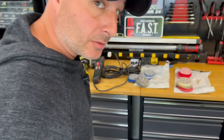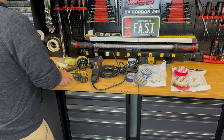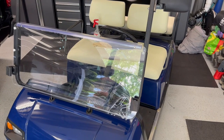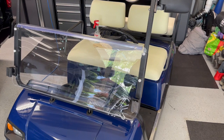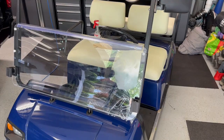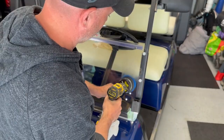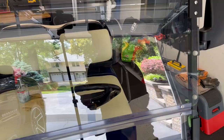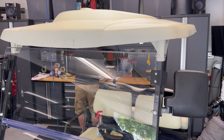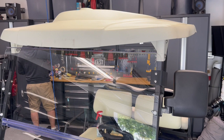Again, this is not a paid advertisement — I got no sponsors. Let's try and get that little scratch out of this front windshield first, then get the other windshield in here and knock that out. The Adams pads will adhere to this Meguiar's little drill buffer. The scratch is gone — I know I've been having a hard time showing it to you, but trust me, it's gone. After you do the compound, I've got to put some polish on it because it does fade it out some. So now we'll smooth it back down with polish, and this should be ready to roll.